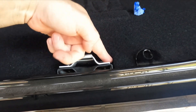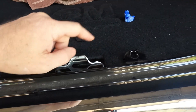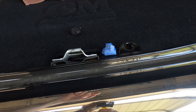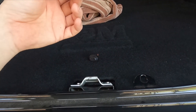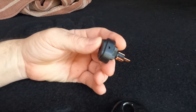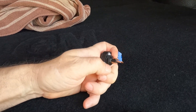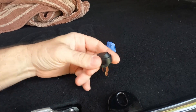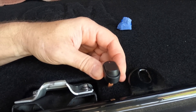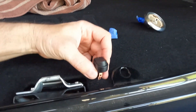I've notched this out and curled the carpet under for the trunk latch so it looks nice. I have an open spot between the latch and the guide pin. I wadded up a piece of masking tape, put it there, and closed the trunk lid to see if it would smash it — it never even hit it. So I'm going to install this toggle switch. This is the only one I've got that's this low profile, and it'll be mounted right in there as my on/off for the dome lights.